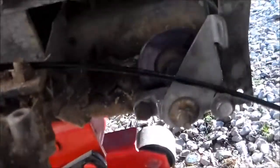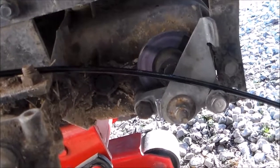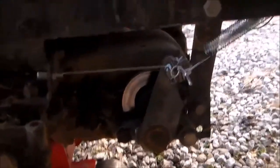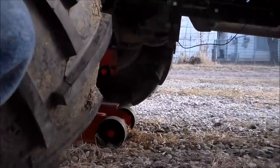Hopefully I'll have brakes again. On this Craftsman, this is where you adjust your brake pressure — I didn't realize that until another YouTuber helped me figure that out. So I'm going to get to work, come up with what I can, and I'll show you the end result. All right, she's set up. Brake lever here, springs right back, and I got it ran like that for now — I'll zip tie it up out of the way. You see when I press, the brake activates automatically, and the spring just helps put it back to neutral, which is awesome. Let me see if I can get this tire on. I'll set you guys down for a moment — I should have brought the tripod up, sorry.